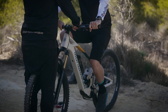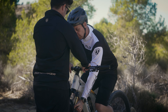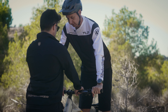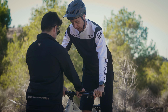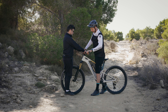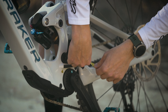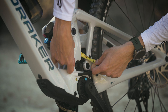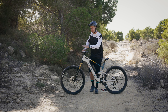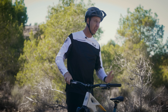The idea now is to get on the bike, bounce up and down a couple of times to let everything settle, then very carefully move the O-ring down to the seal. Then, without disturbing the bike, move into your riding position and gently sit down, put your feet down, and step off. That will give you a good indication of where the sag point is for the front and rear. You can do this leaning against a tree or a wall in your garden, but it's always easier if you've got someone to help — ideally someone who can do this for you so you don't disturb the bike.